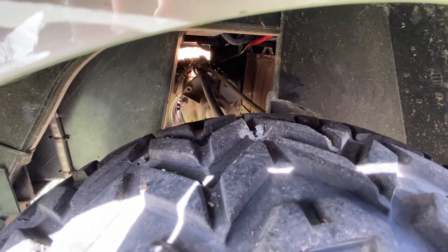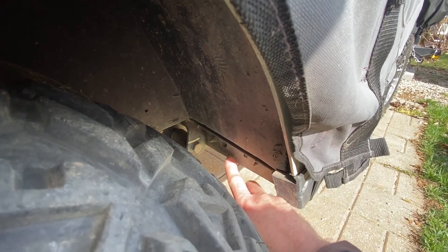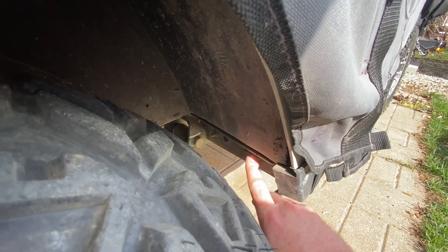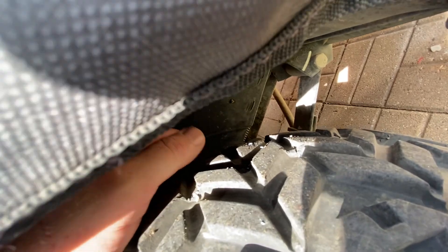There's also a cable coming out of the back of the motor that is for the speed encoder. If you want, you can take off these inner fenders — there are two push clips here, and then another two up in here. You get a little more access to the back by taking out this piece of plastic if you want more access into the motor area.